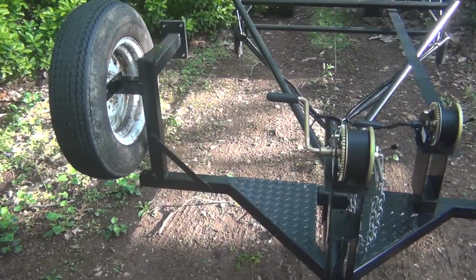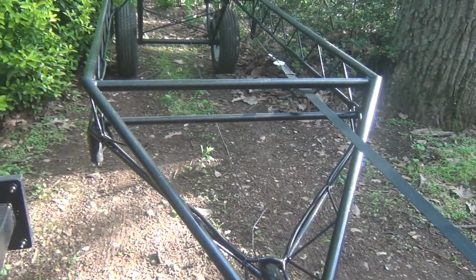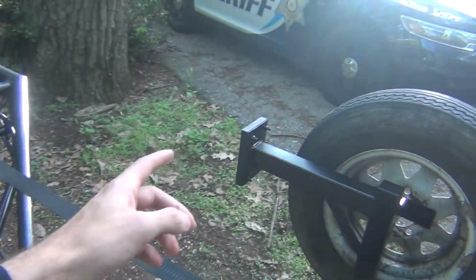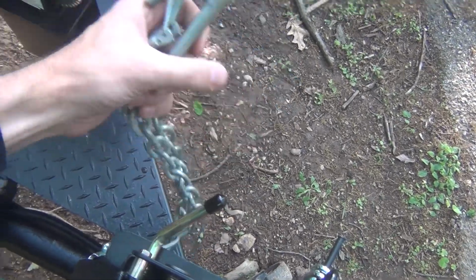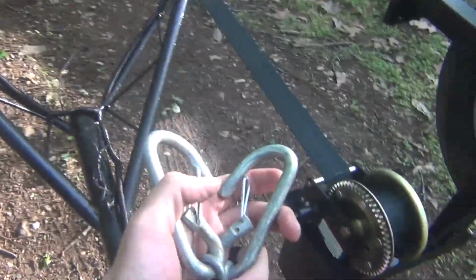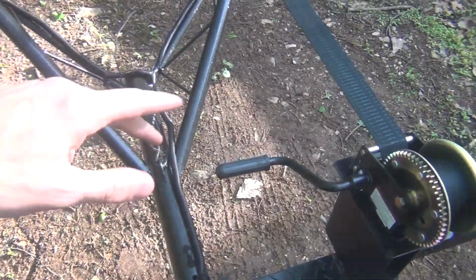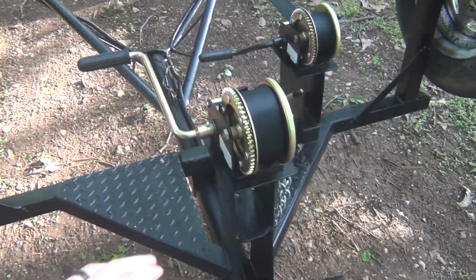So basically what we welded on the front here was new stop points for the boat. So when you pull the boat up on the trailer, it's going to connect with this pad here and that pad there. And the bow crank, we've got two bow eyes, one just inside of each of those pads. So that's what the chains are for. They'll each go to one of those. It makes a Y, so it pulls it around the trolling motor that's mounted center and sticks off.